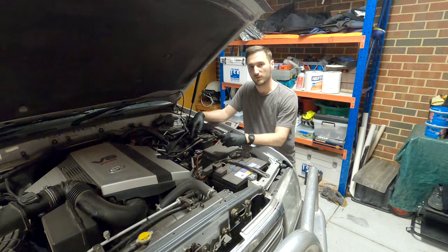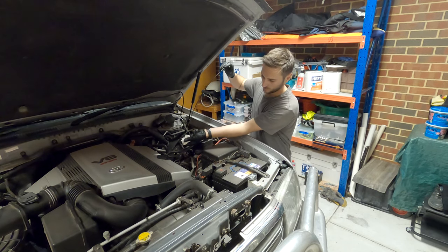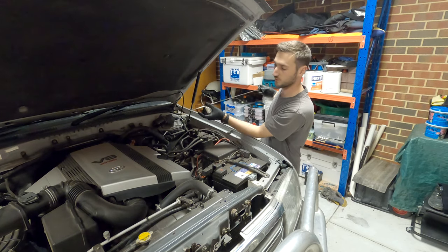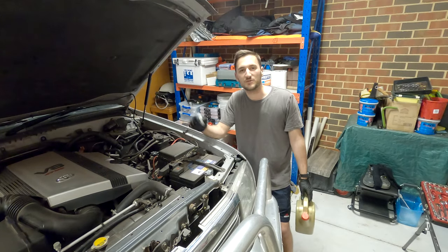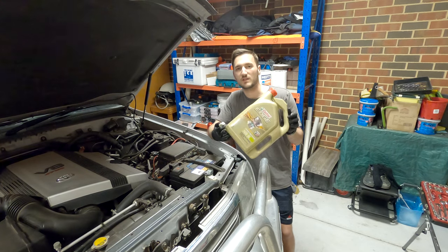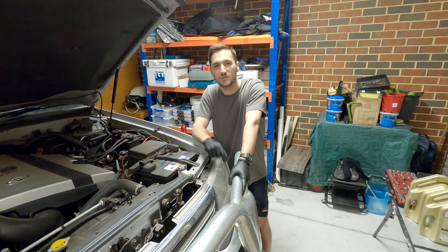Now that we've let that sit for a few minutes, we're just going to check the engine oil level, which is just next to the filler cap. Pull that out, wipe it off, and put it back in. I can see that it's just above the full indicator on there, so I know that it's a good level. That concludes the basic service on a V8 petrol 100 series. To dispose of your old oil, pour it into these containers and you can take it to your local auto parts store. Thanks for tuning in guys — if there's anything else you'd like to see or anything you would have done differently, let us know in the comment section below. We'll see you in the next video.